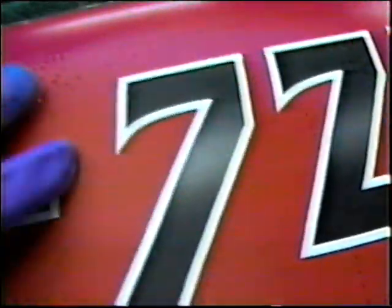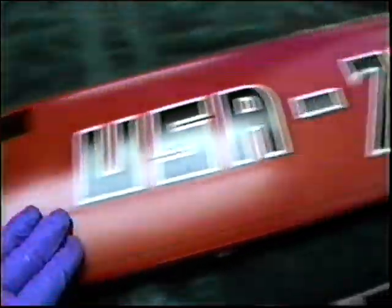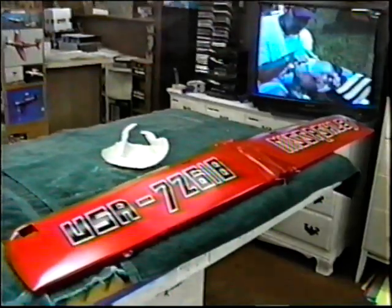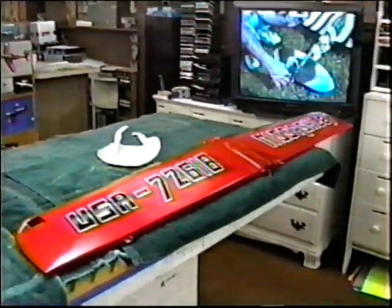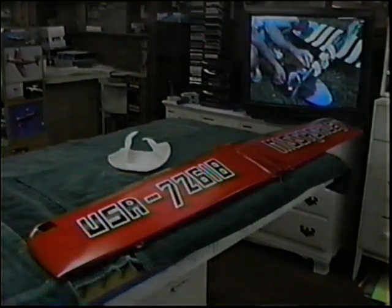As we put the rest of the clear on, you can see what I call the Nomex pattern, or whatever you want to call it. But again, we'll see that this right here, you absolutely cannot feel where the Nomex is. So this may only need one more coat of clear. That, of course, would be very nice. But always, on a big sand out, never try to do it all at once. Break it down over a couple of days and do it. That's the easiest way I know of.